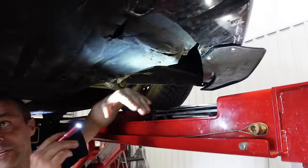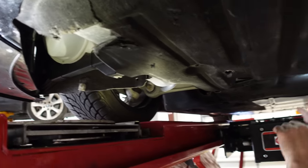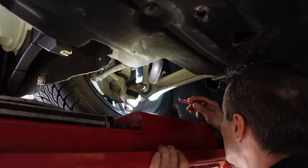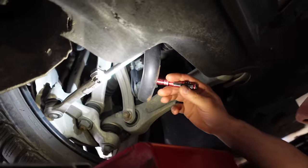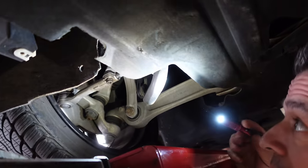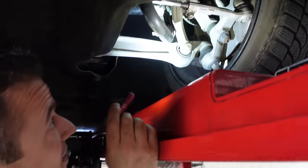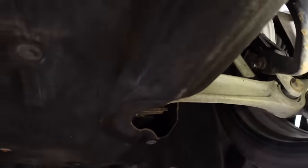Obviously you're missing a couple of plastics here and there. I see the little body trays. It has that corrosion on the steering rack - just kind of galvanic corrosion. Obviously there is some rust on the bolts, which is no big deal. This one has been soaked, so maybe it was aligned pretty recently. The bushings are good. So far so good here.